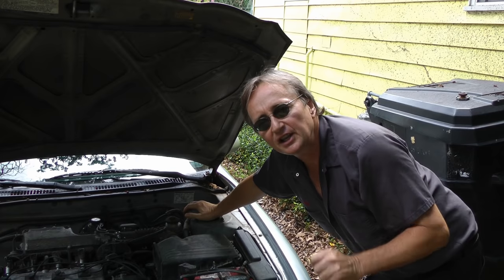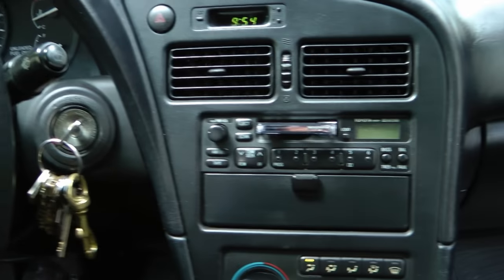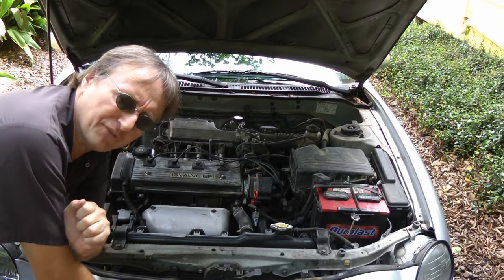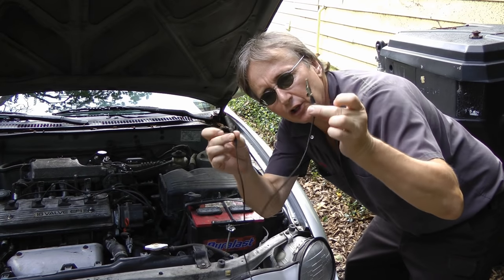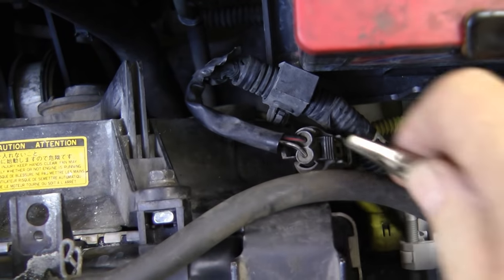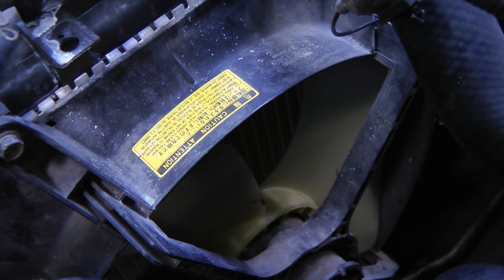Now if that doesn't fix it, the next thing to check is the cooling fans. Start the car up and turn the AC on to full blast, then check the cooling fans to see if they're working. In this case you can see the left fan and the right fan are turning. If the fans aren't working, there won't be enough air sucked through the radiator and it will overheat. When they don't work, check the fan motors — they often burn out. To check if the motors are burned out, just get a jumper wire, stick one end on the positive cable of the battery and the other end on the red cable that feeds the motor. If the fan doesn't start spinning, you'll know the motor is burned out.